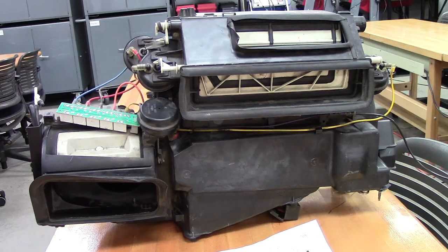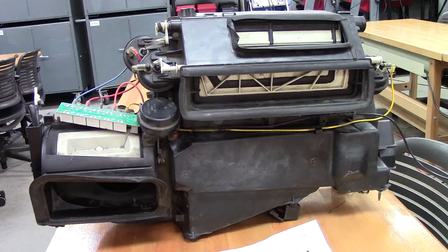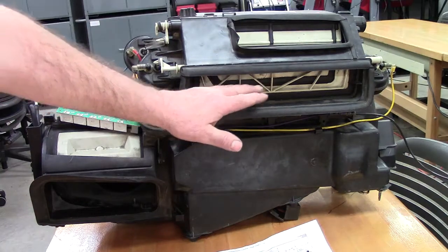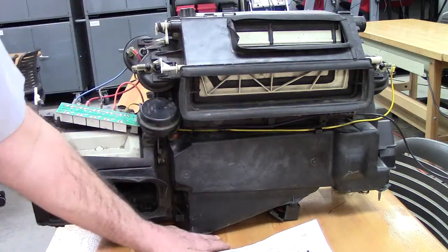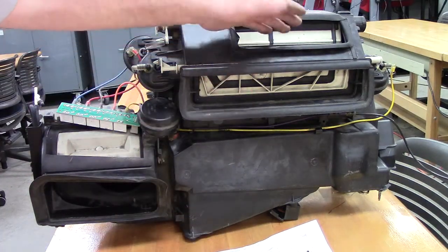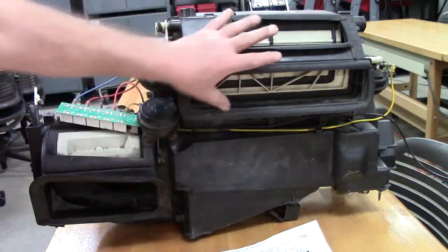In this segment we're going to look at our heater system, and in this particular instance our mode doors or blend doors. There are three different doors that we can control to allow the air to come out of the defrost, or the bi-level, that's the center of your dashboard that we like for air conditioning. With these ones closed, it's going to force the air out the bottom, underneath, where it will get our feet. So by operating these doors we can decide if the air goes up on the windshield, out in our face, or down on the floor, by closing these off.